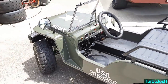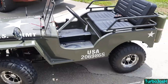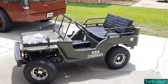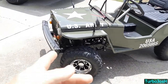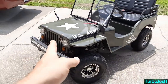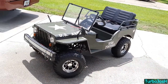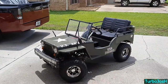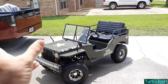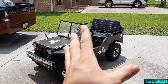I found this mini jeep on a whim and at $1,700 I didn't hesitate to negotiate them down a little bit and go get it. We've had it for about a year now and haven't really had any issues — some typical carburetor issues where fuel comes out of the overflow fuel line because the float sticks. You just give the carburetor a little tap and it usually unsticks and solves the problem. You can tell when that happens because you can smell gas. With a China carburetor that's one sealed unit, it's not shocking that may happen, but as long as you know what to do it's not the end of the world.